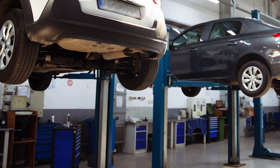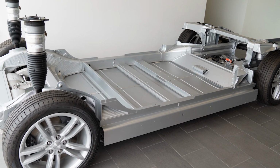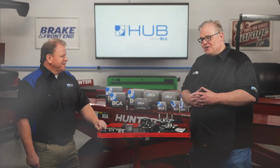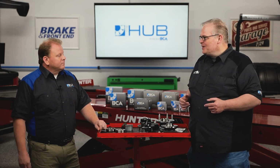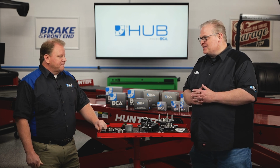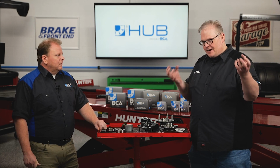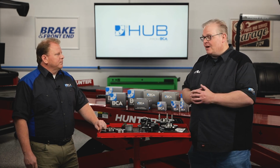The first thing, once they pull into the bay, they've got to make sure that they're very careful with the lift. You think about it, that's just one big battery on the bottom. Battery tray, yeah. So if they're just kicking the arm underneath it and hoping to hit something, chances are they're not going to have any success. No, it's an expensive oops, and there are the 4 mounting points underneath that are specified and called out, so they have to be aware of that. And you can usually see those right away because they're clearly marked underneath.